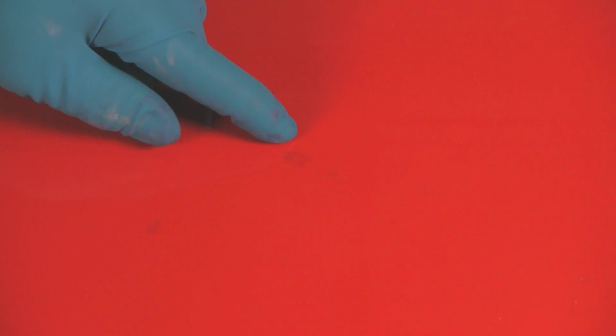Already, this looks a ton better than it did before we started. From a distance, those are going to go away, except for this being a dent. And that would be more body work if we pushed the dent down and then filled it after that. But this is pretty good here. We're set here. We let the paint cure, then we go back with our polish and wax.